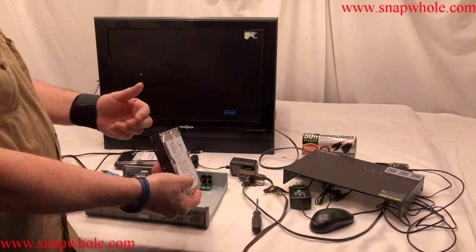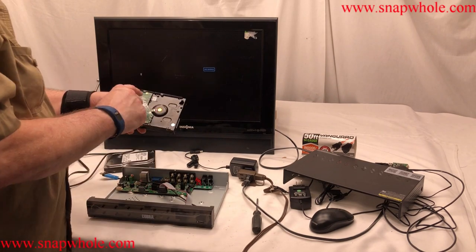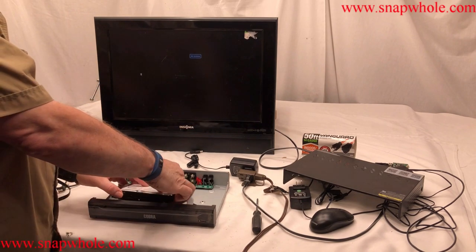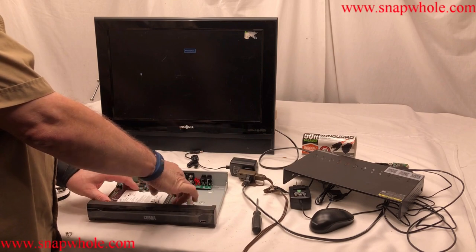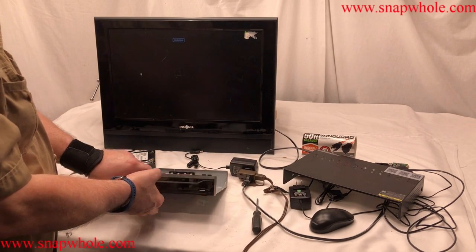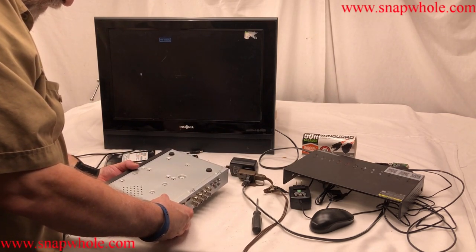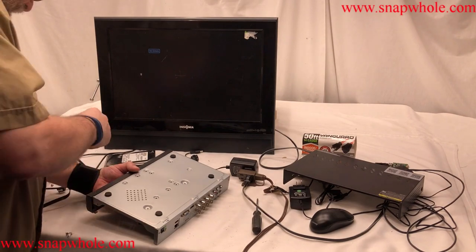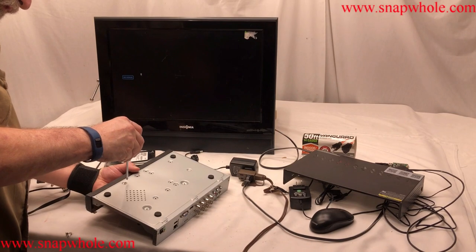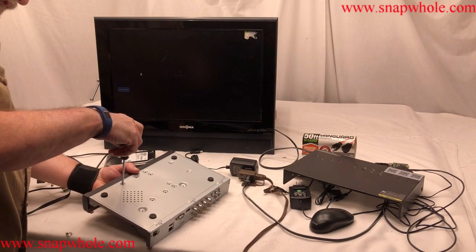The cables go on this end, of course. All hard drives are going to have the same mounting screws. Find the mounting holes, line them up over those four holes, and we took screws out of them. This one takes a little coordination — hold the hard drive in there and find the screw hole. First couple of times it took me a minute to do it, but it's not hard. Moving around the hard drive from underneath to find that is a little difficult because these are raised on the hard drive side.